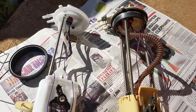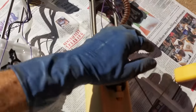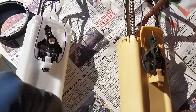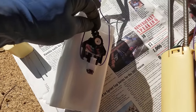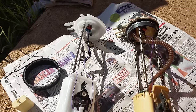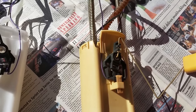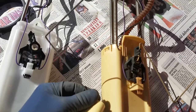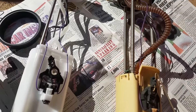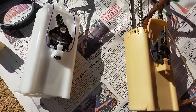You can see the new one on the left compared to the old one on the right. This old one is pretty worn out — you can feel how loose it is, see the play in it, compared to the new one which is pretty tight with hardly any play. That was one of our main problems — it wasn't just the fuel pump that was bad. You're going to have to get your level indicator and pop it on the new one, make sure you copy the old one. Then put your o-ring around here and it's ready to reinsert into the tank.